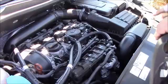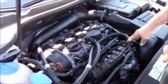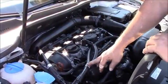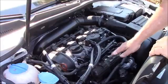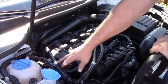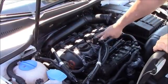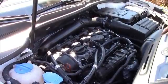How this is going to work: the intake manifold is going to provide evacuation at idle, deceleration, and light throttle, any non-boost operation. Primary check valve is going to close if it senses any pressure from the intake manifold from boost. Secondary valve will then open and use the turbo inlet pipe suction for evacuation after that. Crankcase vapors drawn through the can to scrub, separate the vapors.